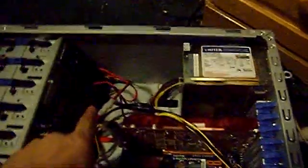What we're going to do is — we could put the Windows install disk onto a USB stick and install it that way, but I don't feel like formatting my USB stick. So what I'm going to do is take this hard drive out and put it in my other machine, install Windows partway on there, and then take the hard drive back and finish the install over here. We're just going to unplug this hard drive.